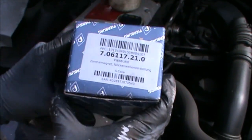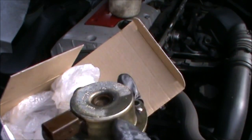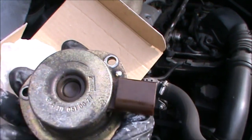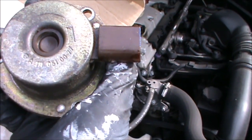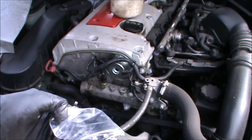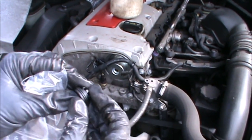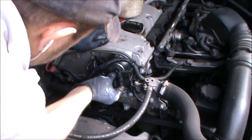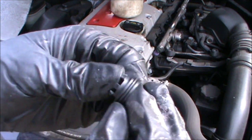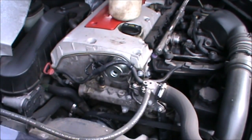It was sent from Germany. The actual part number is A111 0510077. There's a rubber cup here which just needs to be pushed in there. Just before pushing it, there's a little O-ring here, so I'm just going to put a little bit of grease in there so it slides in nicely.